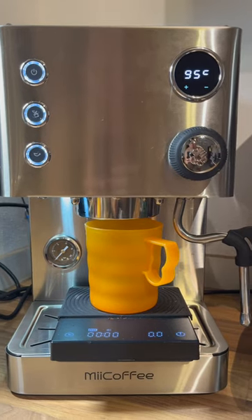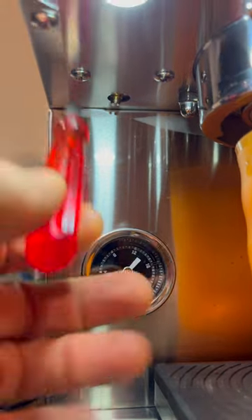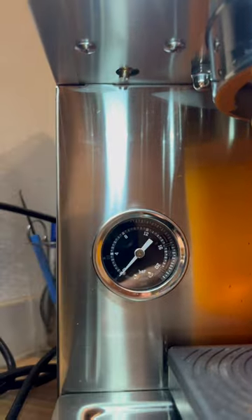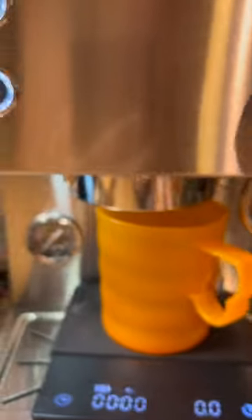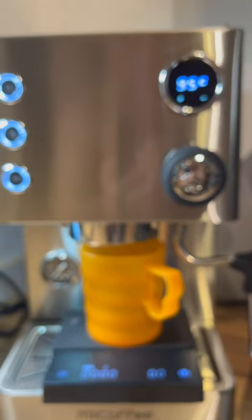On the Mi Coffee Apex, you can adjust the water flow based on this set screw right here. This is in the water circuit of the brew boiler, and I've got it turned in quite far — you can see there's not much left of the thread visible from the outside. I've been able to get a flow rate of right around four milliliters per second.